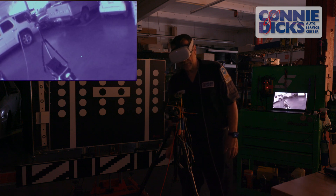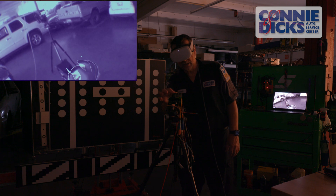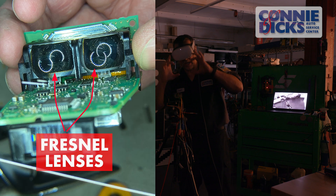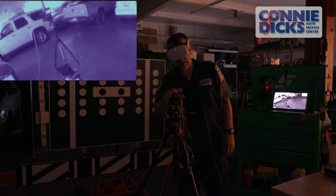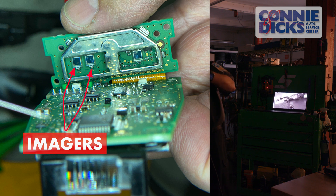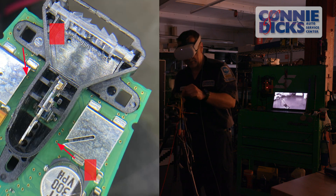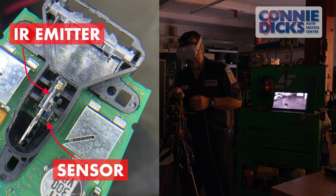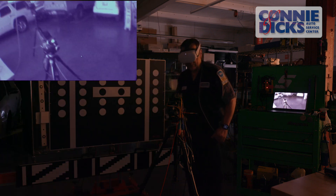It outputs a pattern and has receptors up top. There are two Fresnel-style lenses — like big bug fish-eye type lenses with special cuts in them. I did take this sensor completely apart to examine it. On the back side where the sensing element is, there are actually two camera sensors on one side and one camera sensor on the other. There also appeared to be an additional sensor along the bottom to verify that a laser or near-infrared signal is actually being output.